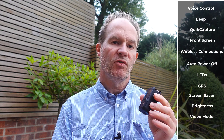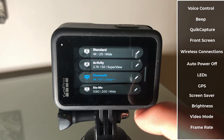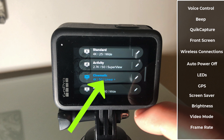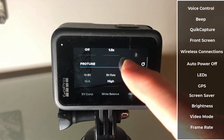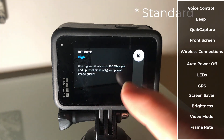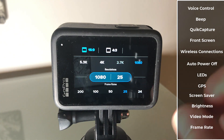If you're happy with HD quality footage, then you can go for the longest battery setting — it's going to make quite a big difference to your battery life. When choosing a profile, select the one with the lowest resolution and frame rate that is acceptable for you, because the higher the resolution and frame rate you record in, the more battery power is consumed. You can edit a profile by clicking on the edit icon, or press and hold the profile button. Swipe down until you see the bit rate — set it to something like normal rather than high, and choose a lower frame rate like 25fps. That's going to make quite a big difference.